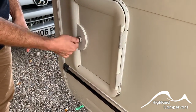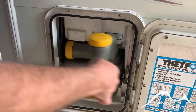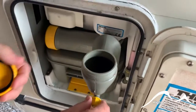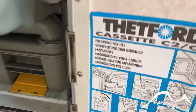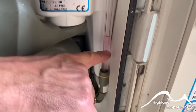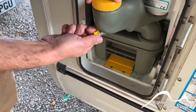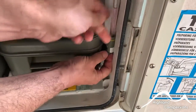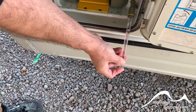Right at the very back you've got your toilet cassette, which comes in two parts. At the top you've got your flush water reservoir — take the cap off and using a watering can pre-mix about a teacup full, or the measuring cup on the base unit full, of pink solution into about six or seven litres of fresh water. Slowly pour it in and you'll see this sight tube slowly fill up along the right hand side. Winter time you'll want to drain it down — take the yellow cap off and pull down on the sight tube very carefully, keeping your thumb over it so you don't spill, then allow it to drain down the reservoir for the flush water.